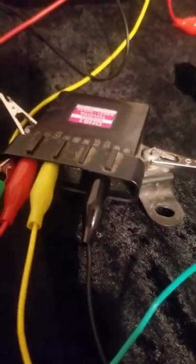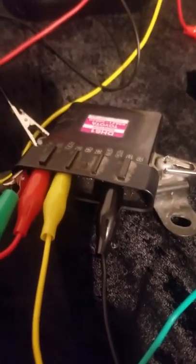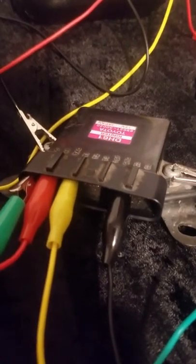Here's a short video on the DH-61 igniter. I've been having some problems lately with a no-start condition. I can smell fuel, so I'm pretty sure the crank sensor and cam sensor are sending a signal to the computer, because otherwise I wouldn't have injector pulses. I noticed I had weak spark, so I'm not sure if my coils are cracked or if I have a bad ground somewhere.